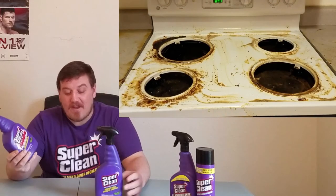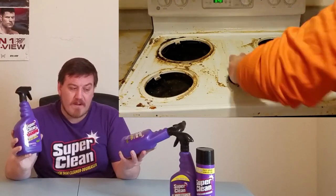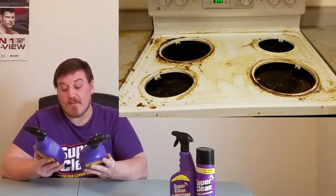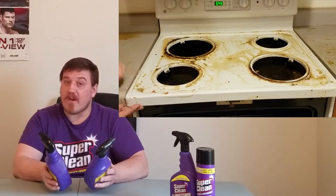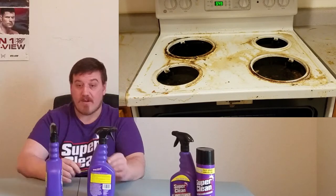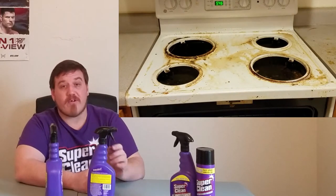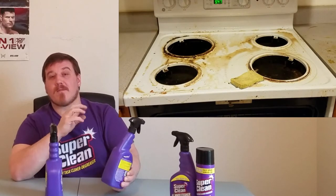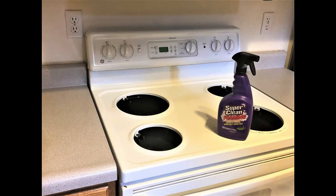This is their product — I'm not really sure how to differentiate the two — they have a normal one and a foaming one, but this one still foams, so they seem to be the same strength, both very, very strong stuff. If you do use any of this, I do advise you — and it even says on the label, so always check your labels — dab it on a rag if you're doing some high-end aluminum. You want to make sure you don't get any chemical burn spots, because sometimes aluminum reacts to certain chemicals, so make sure you check that out, because this is strong stuff.